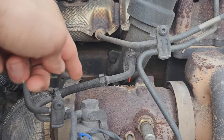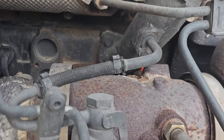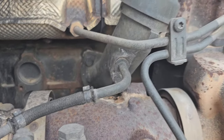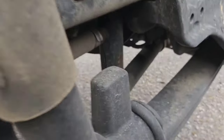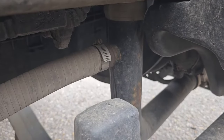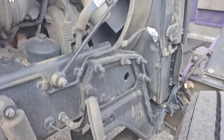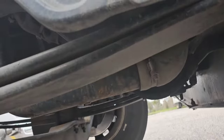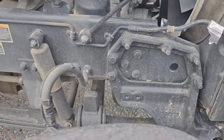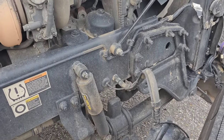What you need to do is just replace this whole line here — I'm sure there's an o-ring in there looking at the way that flange is. You remember in that other video I told you about this clamp here — well that one's not leaking now, but you can tell that clamp was leaking. And then also there on this — they call this a pre-formed cooling hose — and it's leaking. I had one crack on me but that was an older one in a Canadian truck.